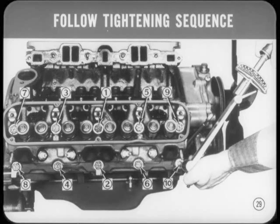When the cylinder head goes on the block, dig out that service manual and pay close attention to the tightening sequence. If you don't, all the rest of your work is going to be wasted.